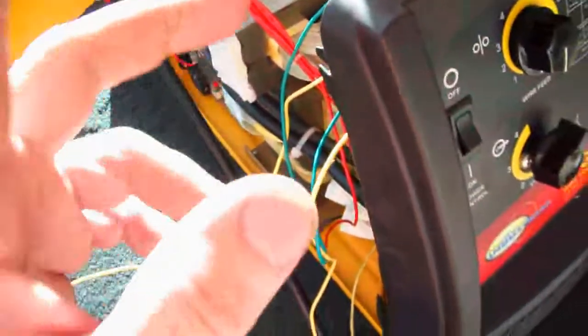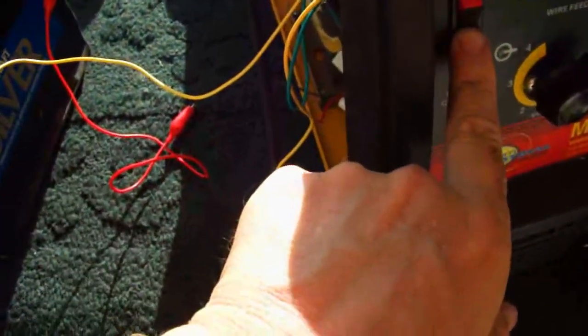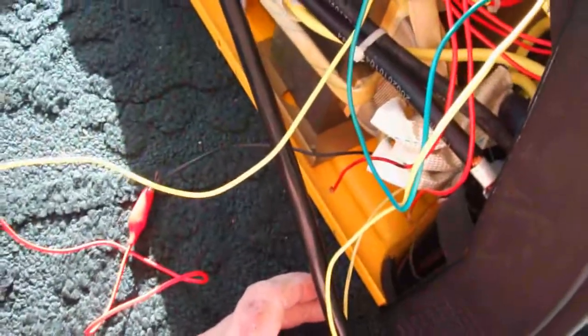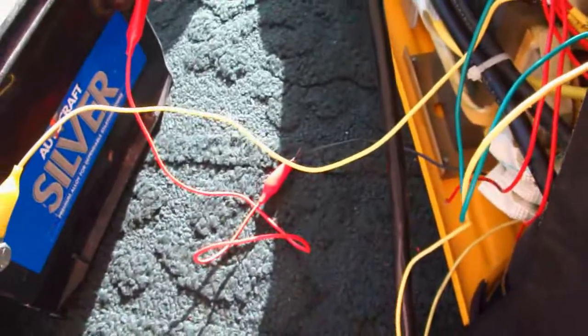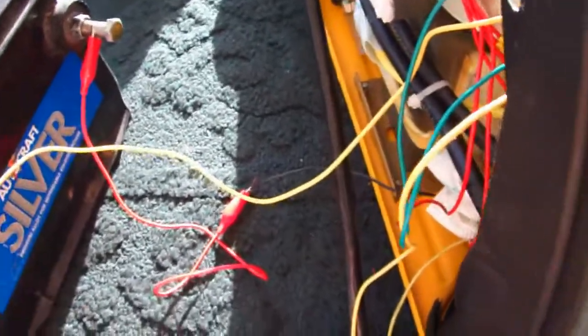I may fix this the rest of the way. What I did was I got the fan to work — you can hear it when it turns on. The fan in the back is working. And I was able to get the little DC motor working too. But then there was something else wrong with it — it wasn't delivering voltage to the DC motor. So there were like three problems: the fan, the DC motor itself, and voltage to the DC motor.